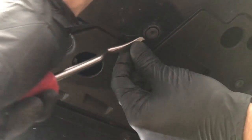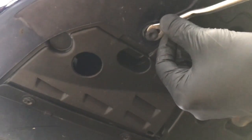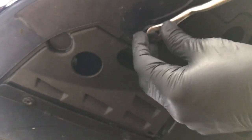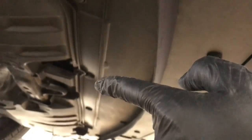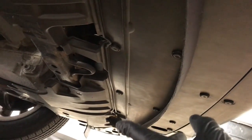These ones on the bottom are tough, and if you do end up breaking them it's not that big of a deal — you can get replacement clips. They're pretty cheap on Amazon also and I'll link to those in the description. You want to work your way around the back side here, remove those clips all along the back. Also, you see this oval hole right here — you want to remove the clip that's right next to that. But these other clips you don't have to worry about, they come off with the bumper. Just work your way down the back and take all the other clips out, and the other two on the driver's side just like we did on the passenger side.